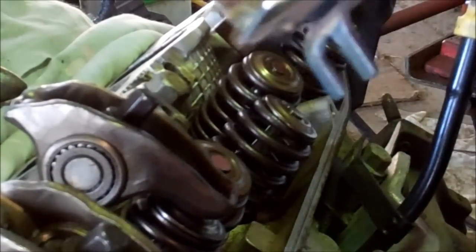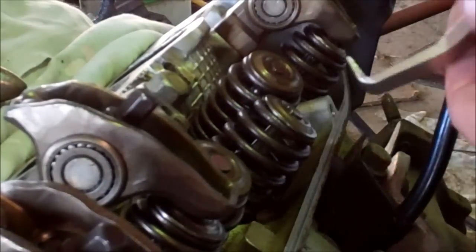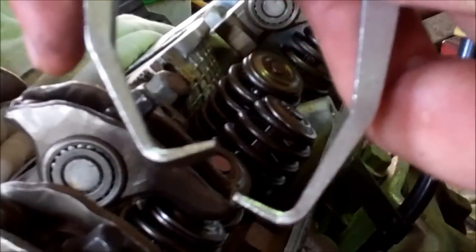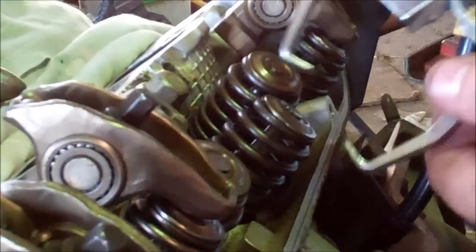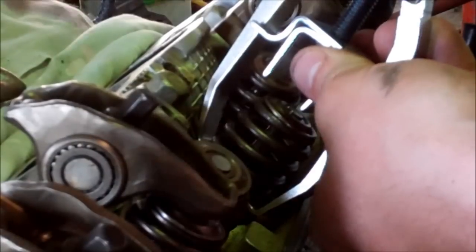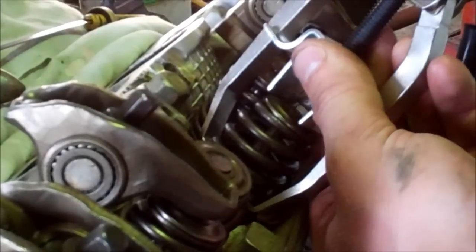You can't block up both sides of this though, because you need to be able to get in here to do the retainer clips. You'll notice there's a long and a short arm — put your long arm in. The oil dipstick's in the way, but spin it down.